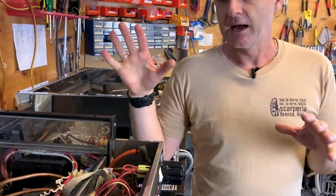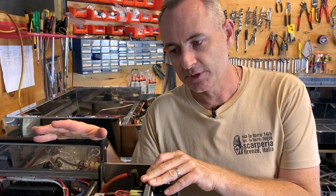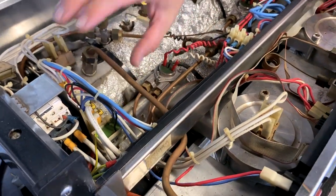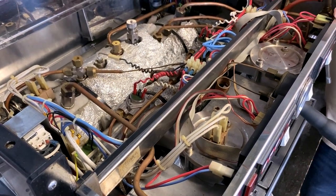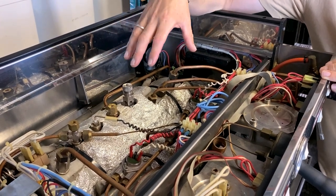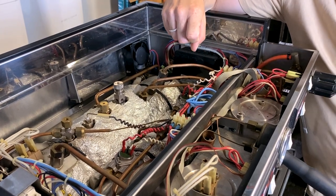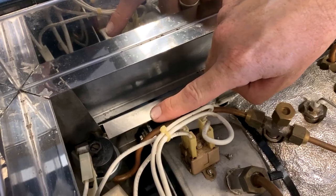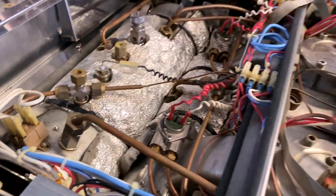When we have a look inside the Classic, we've got to remember it was built around 2004, maybe a little bit earlier. Over the years things have been added to it, but predominantly the main way it worked was through this contactor which would turn the elements on and off — they can get quite noisy when they're on the way out. There's one level probe here for water, and it does have a digital PID controller still for the front brew boiler underneath the machine. The rear boiler is still controlled by a pressure stat in the back corner — you screw it up and down and once it reaches about 1.2 to 2 bar maximum, the element cuts out. That's a big change when we look at the next machine.